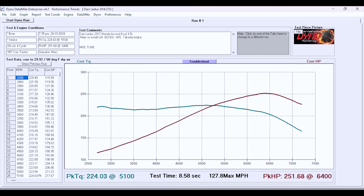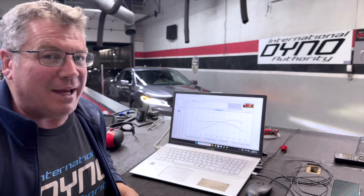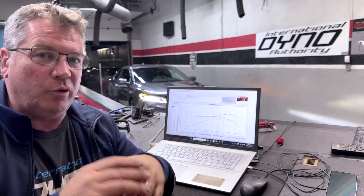We weren't seeing any increase in power, and we were seeing that if we pulled some fuel it would go right back, because this thing is obtusively rich — it's terrible. We just got it to stay in the 12s and made a bunch of power. The minute we got this thing to actually stay where it should, we got it out of the 11s and into the 12 air-fuel ratio — 12 pounds of air to one pound of fuel — and it made beautiful power. So when it came in it was making 201 horsepower. We are now, with the cold air intake and the tune so far, at 251 horsepower and 224 foot-pounds of torque, up from 182 foot-pounds when it came through the door.